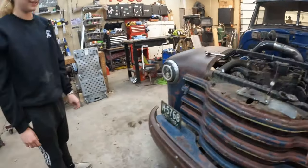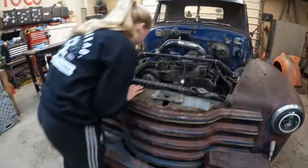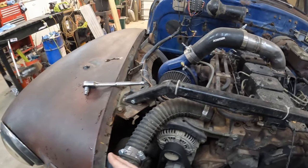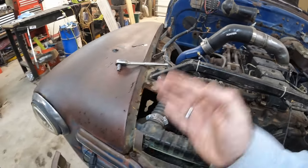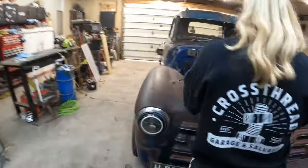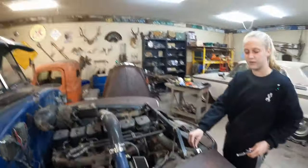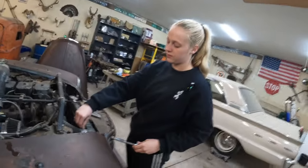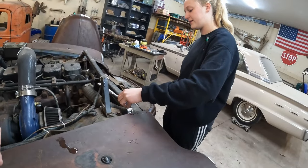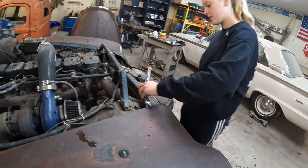Why don't you turn it sideways so it's underneath the entire radiator? Oh, actually, this is the inlet and outlet side, so everything's going to drain from this side. So you're right. You did that right. Yeah, you did that good. You knew what's going on. So while Caitlin's getting that upper hose off of there and starting to drain. Wait, I'm actually like doing it right. Yeah, I don't know why you're starting at the top. Normally, you want to start at the bottom. Well, I saw it, and it needs to come off. It does need to come off, so sure, it's on you.